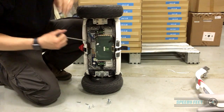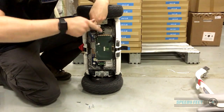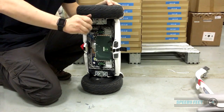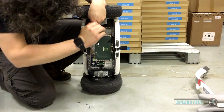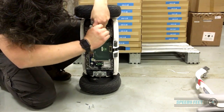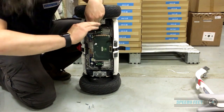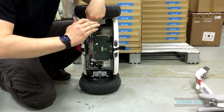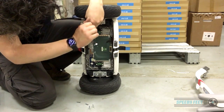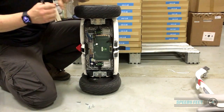You need to torque these bolts back up to the same tightness as they were originally, because if they come loose you'd have a serious accident — the whole wheel and motor unit will come off, and so will you. Torque them back up nice and tight. Be careful not to cross-thread them because otherwise you've ruined it. Once tightened, double-check they're all really tight, because sometimes tightening one can slightly loosen another as it compresses.